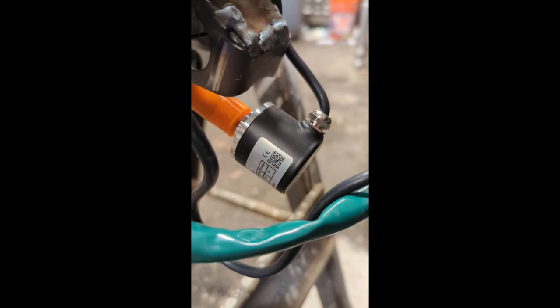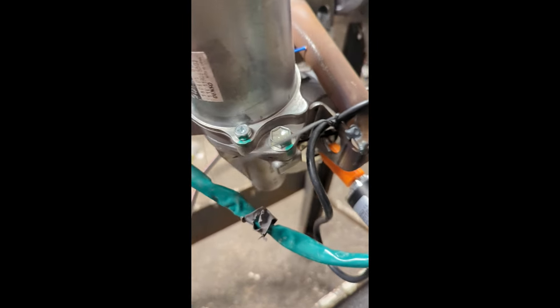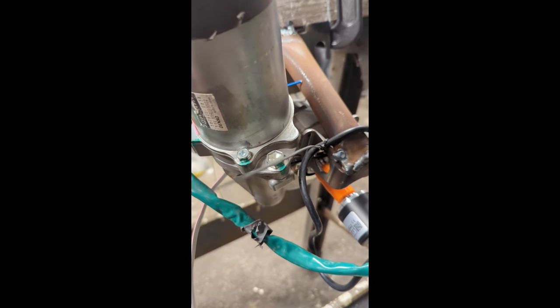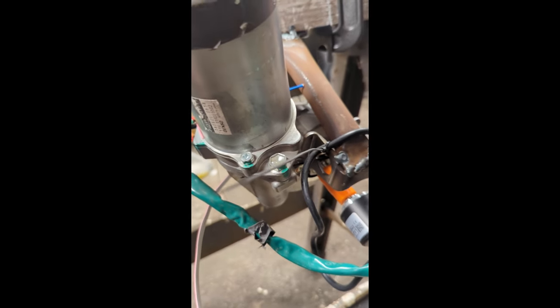It gives us 10,000 pulses per revolution total. That servo feedback loop is going through the gearbox — does that spell calamity for us? No, it doesn't. The boys at Toyota did a really good job figuring out how to make this work for 180,000 or 300,000 miles, or however far these things go.